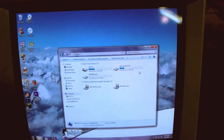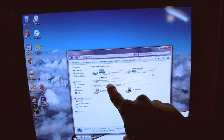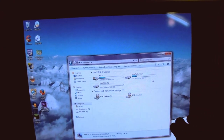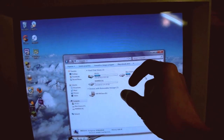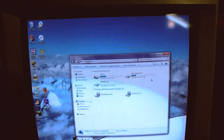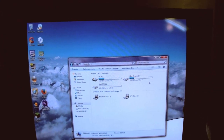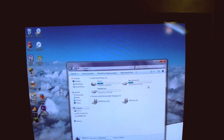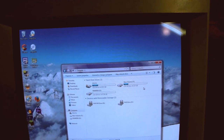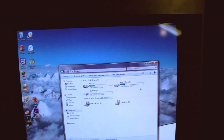So I have a 4.4-gigabyte RAM disk which I have labeled R for RAM. Anytime I have videos from my camera, I can import them into that RAM disk and access them really quickly with Adobe Premiere. When I'm rendering, I can render from there as long as I have space on the RAM disk. It'll be very fast and I won't be slowed down by an SSD or even a hard drive — it can go as fast as the processor can handle, because the data bus between the processor and the RAM is about as fast as you can go on a computer.